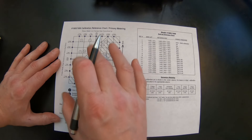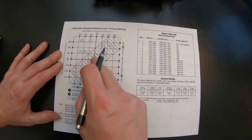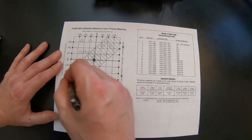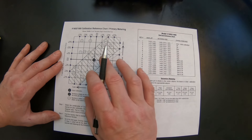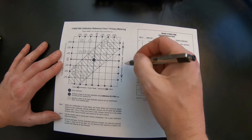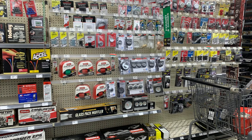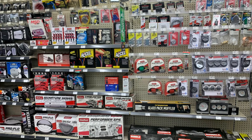The tuning chart that comes with that carburetor — no other carb manufacturer gives you that level of detail. If you're having a specific problem with fuel delivery, it tells you exactly how to fix it. Once you understand it and someone explains it, it's a wonderful tuning tool that makes the drivability of these carburetors that much better. There is also an endless supply of local support — most O'Reilly stores carry a few rods and jets and have calibration kits. If they don't have the calibration kit in stock, it's usually available that day or next day depending on where you live.